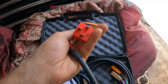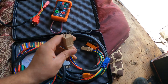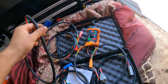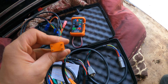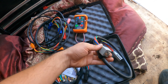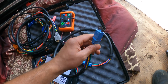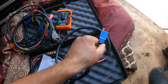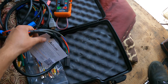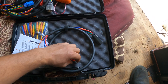Looking at the adapters, you've got a four-pin relay, a micro five-pin relay, and another five-pin relay — this covers many relays you might encounter. There's also an ISO micro adapter, and on the back of each adapter it has a diagram of the relay showing the control side and load side. The last adapter lets you use the provided test leads and go into the relay yourself.